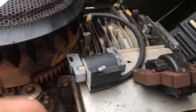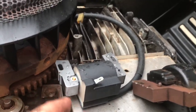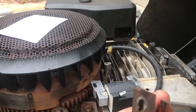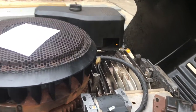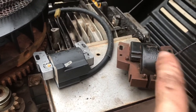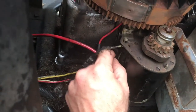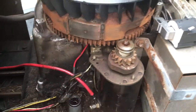I've got the old coil and the new coil here so you can see the differences. The new coil is a little bit smaller — same part number but I think it's been updated over the years. One other difference is that the kill wire connection point is a little bit further over to the right on the new one, so I needed some more wire because it wouldn't reach. I just had to reach down into the loom and pull a little bit more wire through.